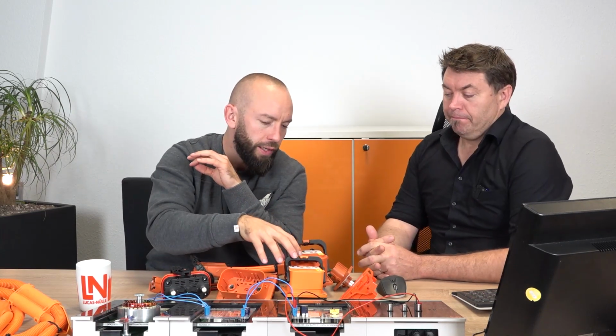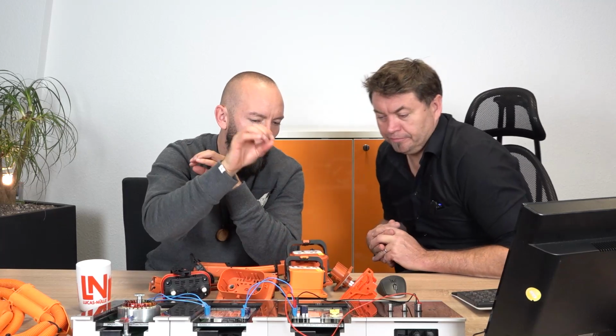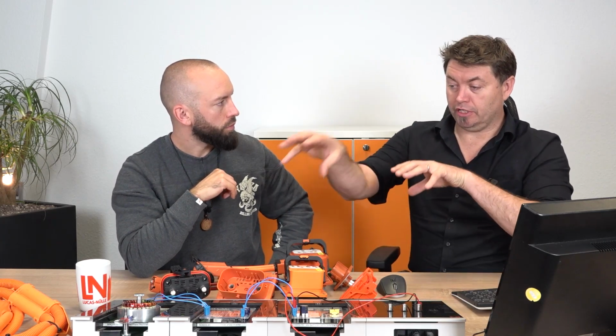So all these things don't help us when there is a fault inside the high voltage relays and they won't open. Yeah, exactly. So that's the relays. Some people call them contactors, system main relays, whatever it is. They're the relays that connect the high voltage battery to the rest of the vehicle, the inverter, the electric motor, the AC compressor.